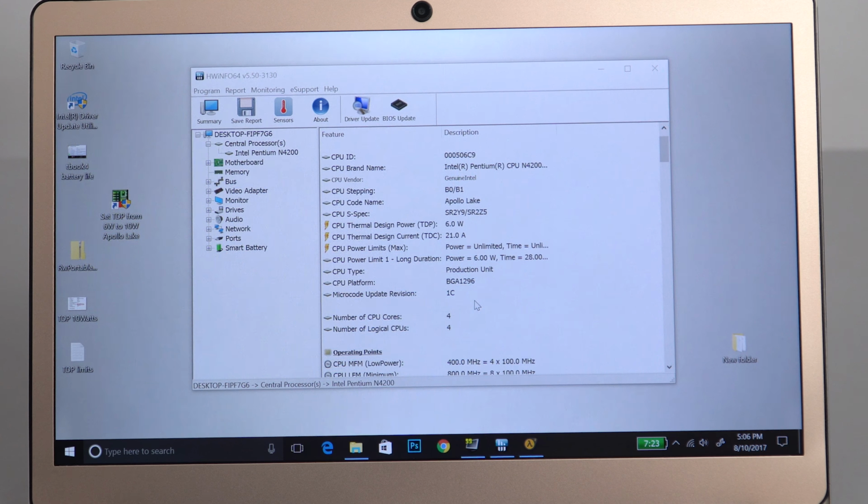Now, if you want to do this mod yourself, I recommend that you check out the forum link. But first, make sure that your laptop is like the EasyBook 3 Pro. So it's got a good copper heatsink in there, and that is very important to do this mod. You must have a good heatsink on there. Laptops like the Lapbook 12.3 and then the 14.1 do not have good heatsinks in there, so they will reach thermal throttling temperatures straight away with this mod.